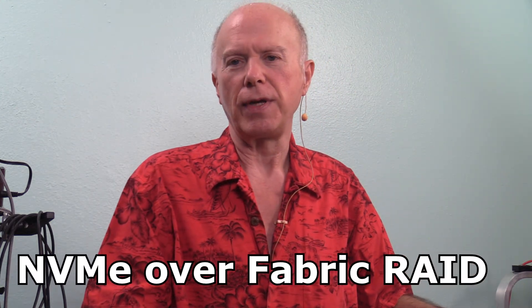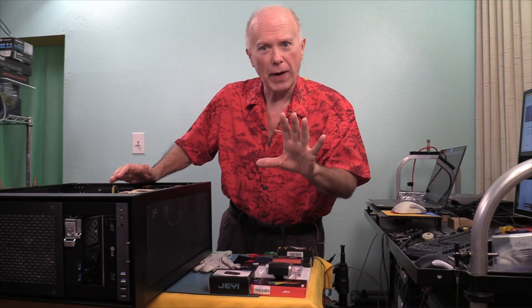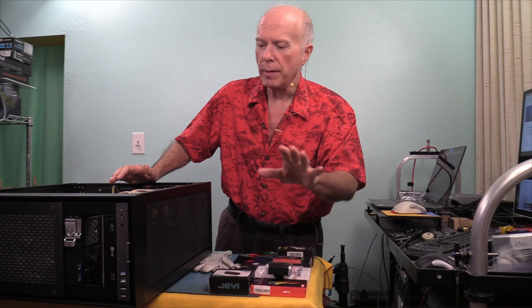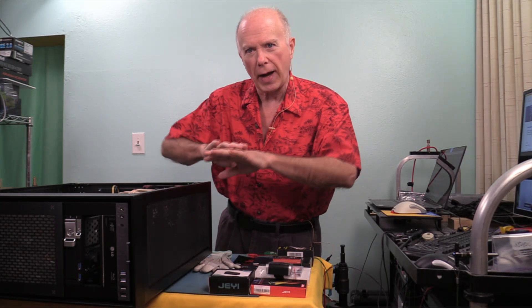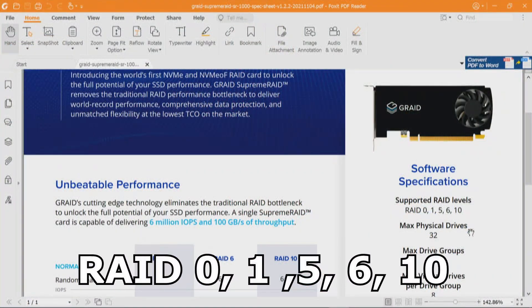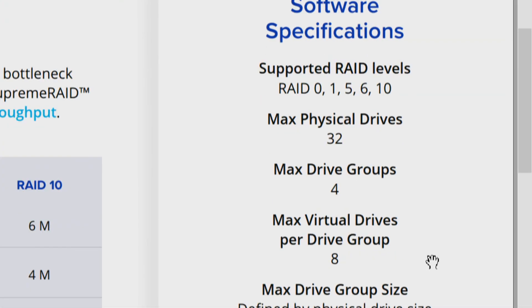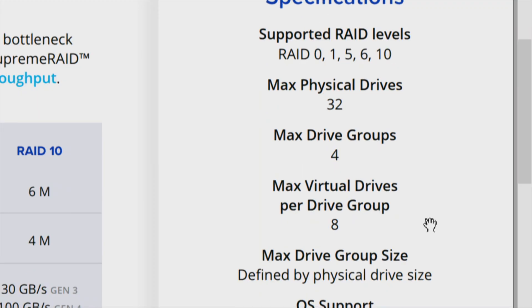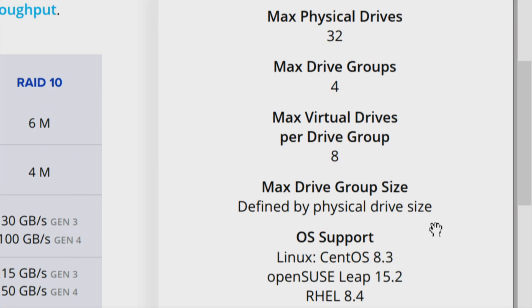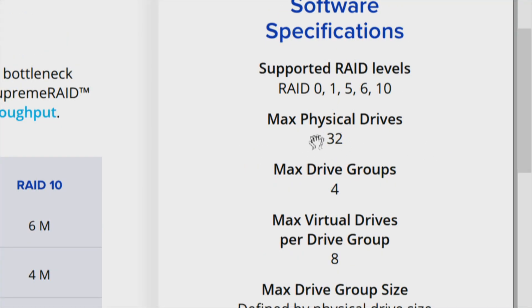There are two ways we can go with this. We can look at this as a standalone machine, or as one machine being one node to plug into NVMe-oF fabric. For those looking for more than just RAID 0, 1, 10, and 5 — and even though you can do RAID 5 on a hybrid BIOS RAID, the advantages are different — we can do RAID 6 with GRAID. The supported RAID types: we can support 32 physical drives, 4 physical groups, and a maximum of 8 virtual drives per group. This is supported on various flavors of Linux, Windows Server, and Windows 10.